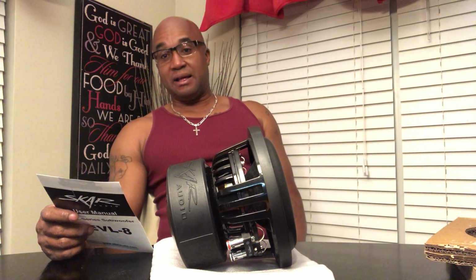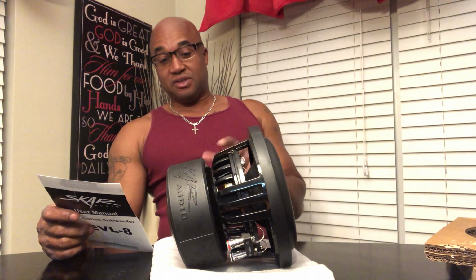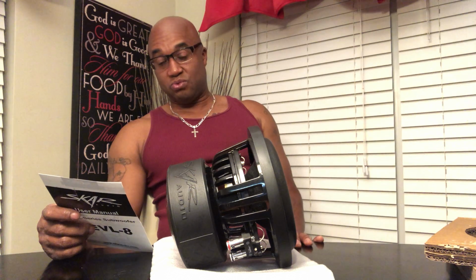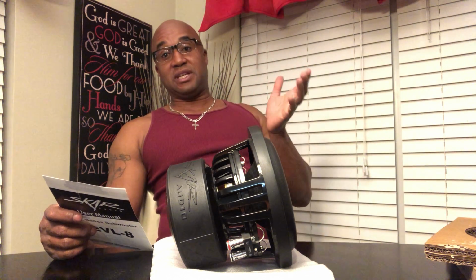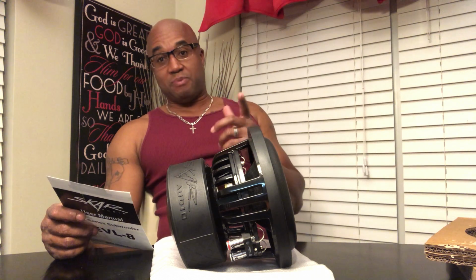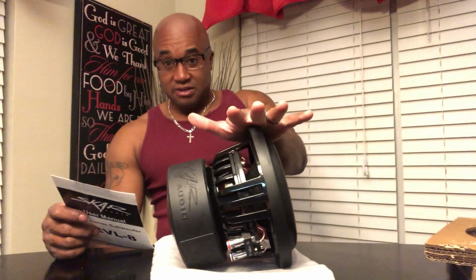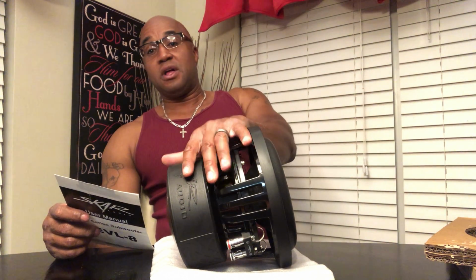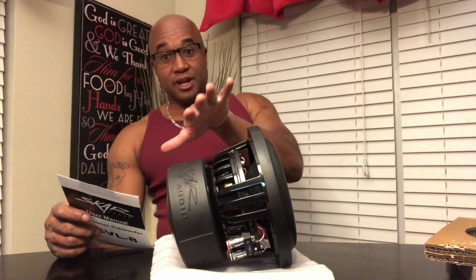FS is high for a subwoofer that y'all tell me plays pretty low. The FS on this sub is 52. And the Evil series is supposed to kill lows. The FS is 52. That's pretty high. So I'm going to get less resistance at 52 hertz. I'm going to get more power there. That leads me to believe it's an SPL subwoofer, not a sound quality subwoofer. Most sound quality subwoofers are below 40, like 39, 34.